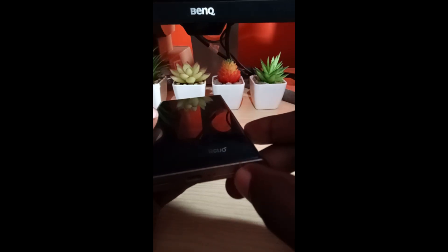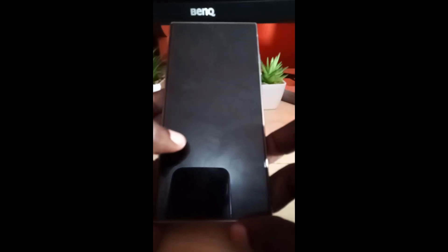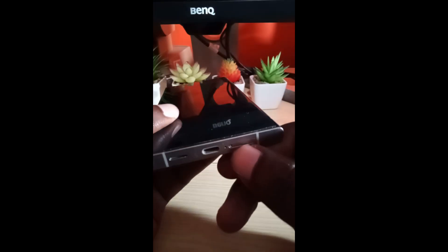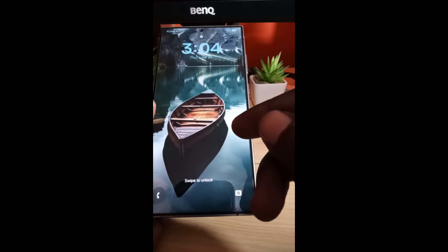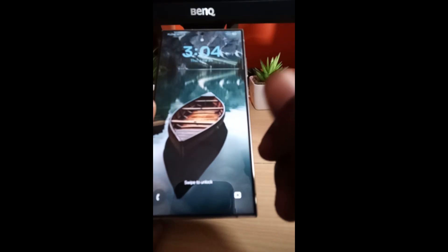Also make sure the tray is not damaged and the port is not obstructed. If you're still seeing 'no SIM,' try switching to a new SIM card in case yours is damaged. Make sure the metal contact is solid and not broken, and clean off the contacts — sometimes it's simply not making perfect contact inside. Cleaning the metal surface helps fix the issue, especially on micro SIMs.